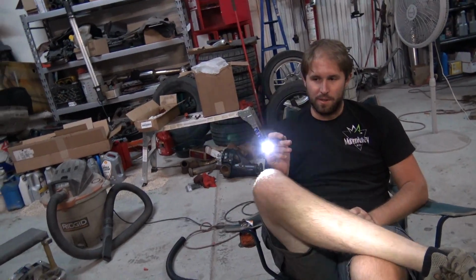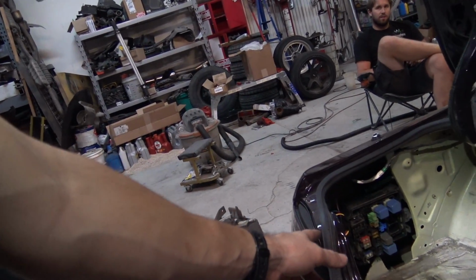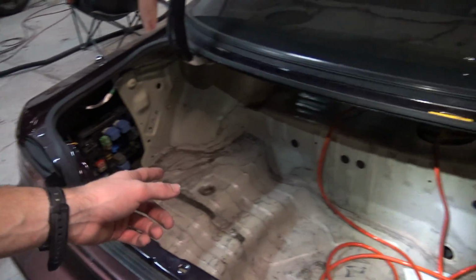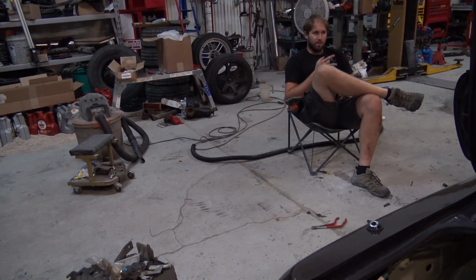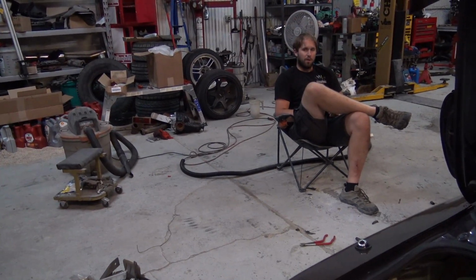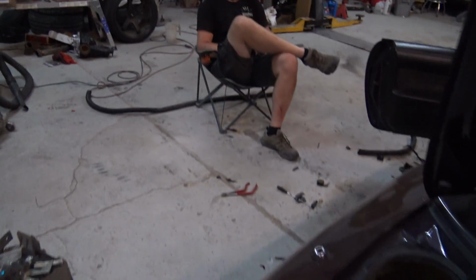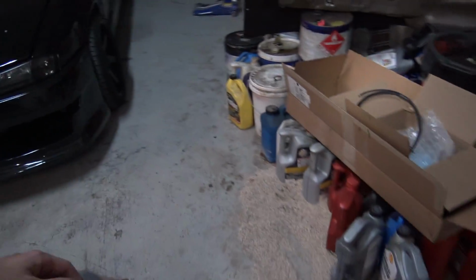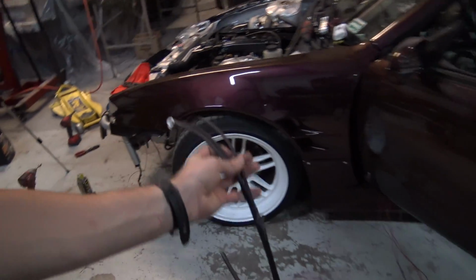Maybe. I mean, we have to. Well, we need to. So we need to give this fuse box power, and then we also need to give the starter power. I think that's it. You give the starter relay power. Doesn't it get power from back here? No, the fuse is up there now. Oh, okay. So we need to give a couple things power. Grounds, and we need to ground the block. So I also got this thing from Wiring Specialties. This is their 5-point grounding kit, which I'll probably add a bigger one to the block, but we'll add this up top somewhere.